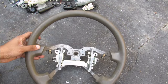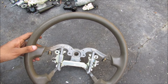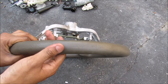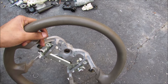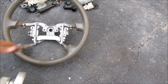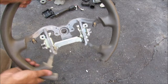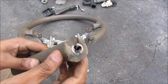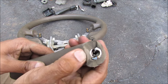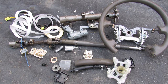This here is the steering wheel. It's got a metal frame that goes all the way around, and the center is beefed up to hold the force of the air bag. This one is coated with that soft rubbery material that's on the dashboard — luxury models will actually wrap the entire steering wheel in leather. I'm going to cut off the bottom of the steering wheel to get that sporty D-shaped look. Inside the steering wheel we've got tubular steel that's hollow, coated by a thick layer of spongy material. And that's pretty much all the components that go into making the steering wheel assembly on your car.